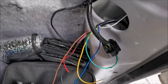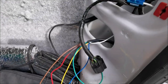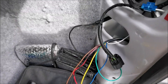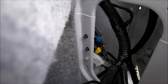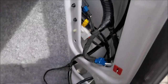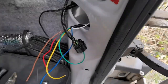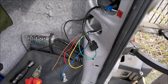I've got to trace back for the green. The yellow one on this cable will now be the opposite side. I've got a bit of a dilemma — unless I can find where this goes, I'm going to have to drop another cable across to the other side, possibly two, possibly three cables. I think I'm going to just try one for now for that indicator on that side. And if I can find that one with one cable, it's fine. Because I'm using LEDs, I don't think it's going to put any strain on the stop and tail lights left and right — it doesn't really matter about them because they're just stop and tail, so they're either on or they're off.